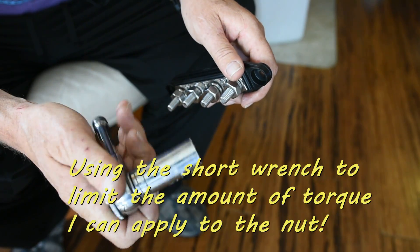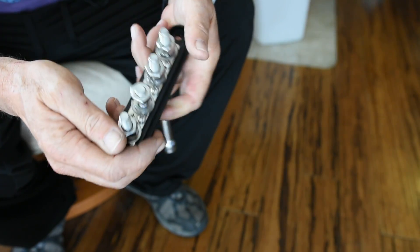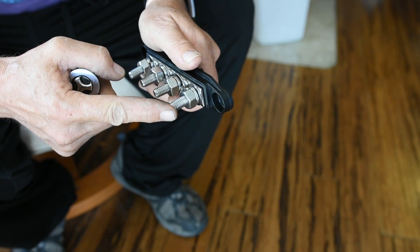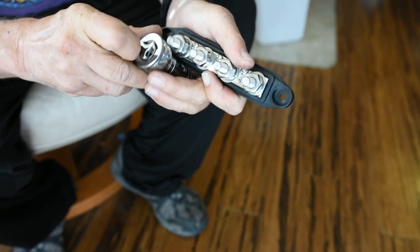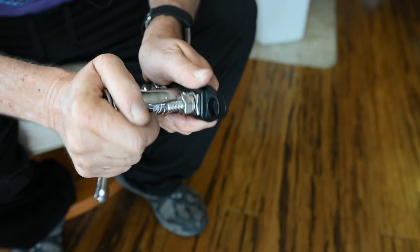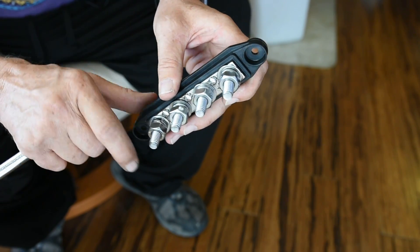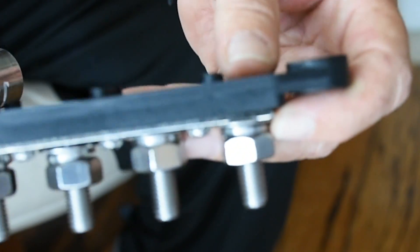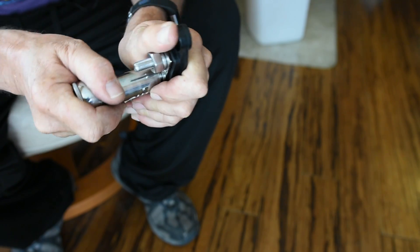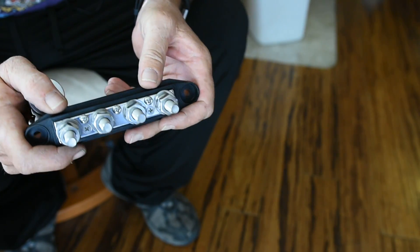I have here a little short stubby socket, and I'm going to tighten this bolt. I want you to see that it's working freely now. By the way, I've already seized the other three of these, but I'll show this one to you because I was testing to make sure it just wasn't me. So I'm just going to tighten this down. You can see I'm not over cranking on it — that's just snug. I would actually like to have it a little snugger than this in my RV. If you look there, the washer's just barely compressed. Now, here's the trick. Let's try to take it back off. You're done. There is no amount of force you can put on those to get them off, so you're taking your chances if you buy this bus bar.